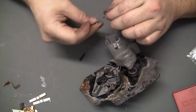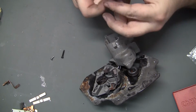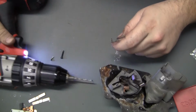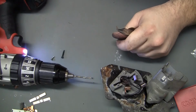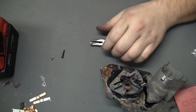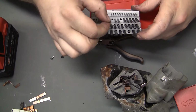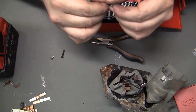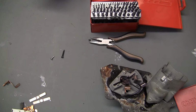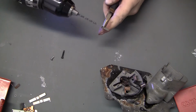Let's see. Plus I need to drill these bigger too. That's going to be a challenge. Definitely need to find a better bit. Okay, so according to my drill chart, number 35 is a 0.11. Oh, mine looks incredibly dull. But also, number 34 is a .111, and number 33 is a .113. So this potentially could all work also.